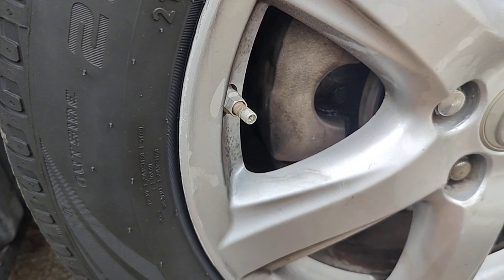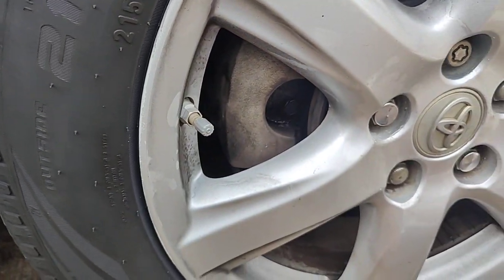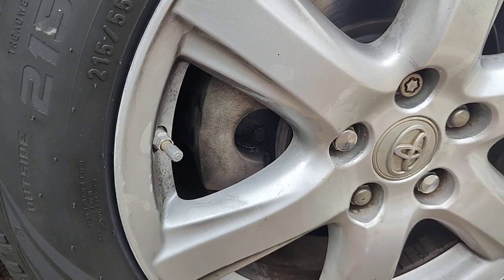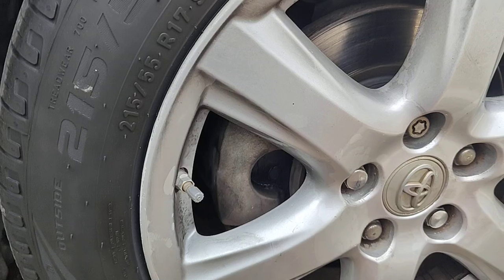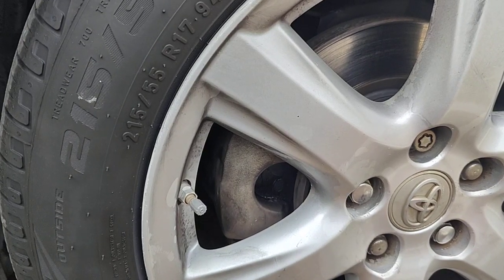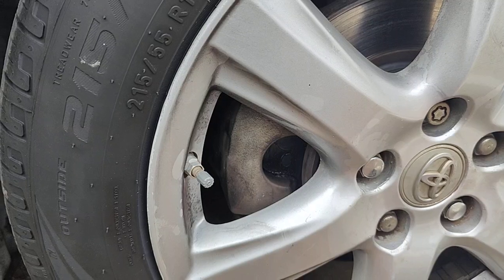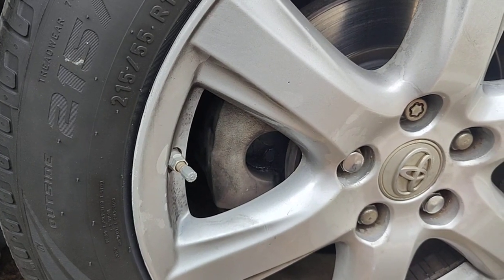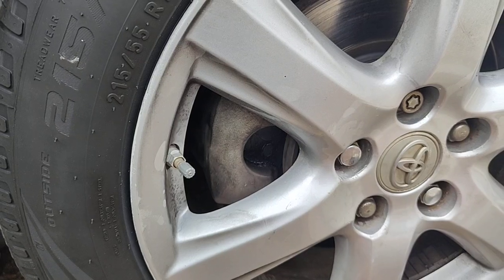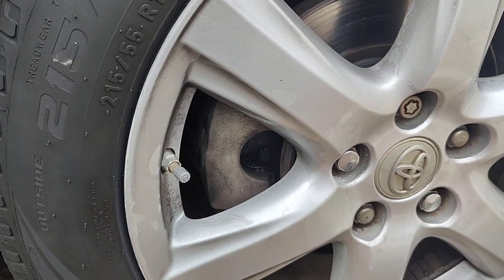That's going to give us a nice smooth ride, the best fuel economy possible, and is going to probably alleviate all the rough riding we've had with this, all because all the tires were over twice what they're supposed to be. About 61, one was 68, a couple were 58. Do not have your tires over-inflated like that. There's no need for it. All you're going to do is possibly cause uneven wear, but you're definitely going to give yourself a rougher ride.